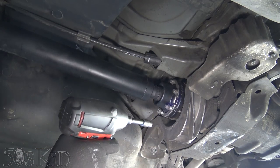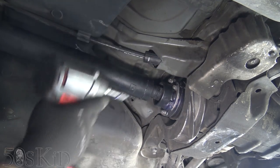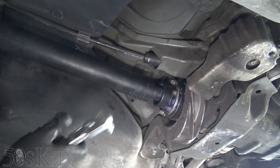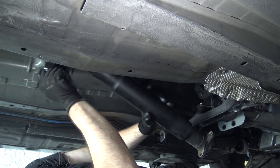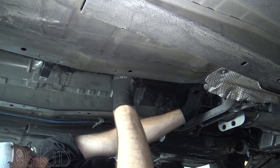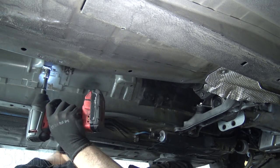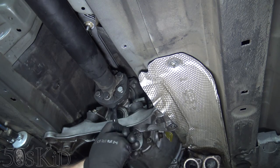I'll display the torque on screen. I need the whole drive shaft to be fully installed first before tightening, so I'll remove the bolts holding up the center support bearing so it can pivot down and we can put the drive shaft up into place. Let me get these bolts back on.